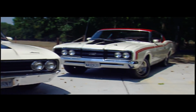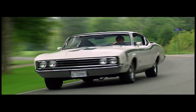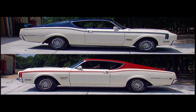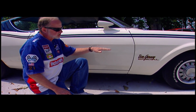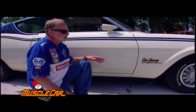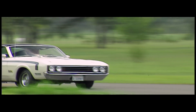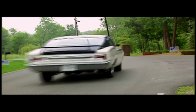But it wasn't just the front end that needed some improvement. Spoiler 2s had to have the same ride height as their racing counterparts. NASCAR took that measurement from the rocker panel to the track. By rolling this in and raising it, it allowed the race cars to be lowered an inch in all reality to achieve the distance that's on the Spoiler. That allowed the cars a good several miles an hour on the super speedways and much better handling by being closer to the ground. These cars came equipped with a 351 Windsor backed by a 3-speed automatic transmission.